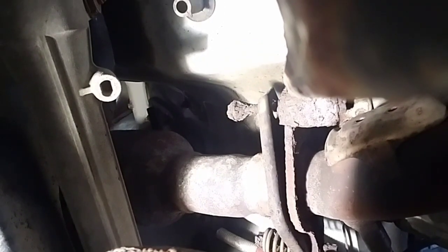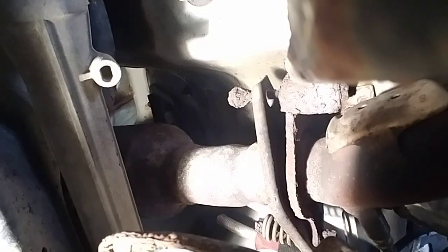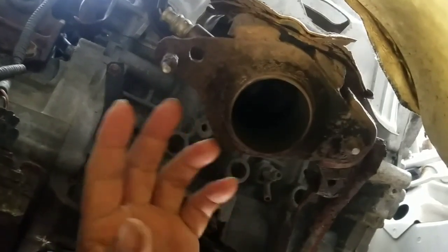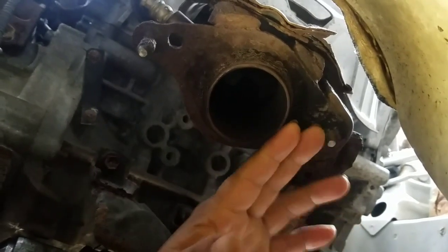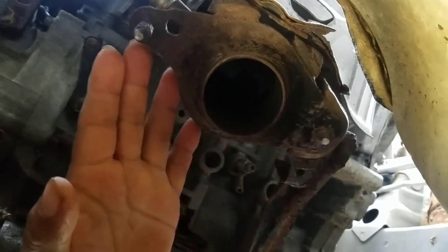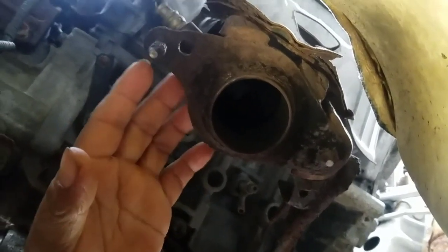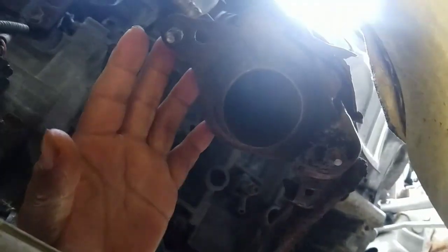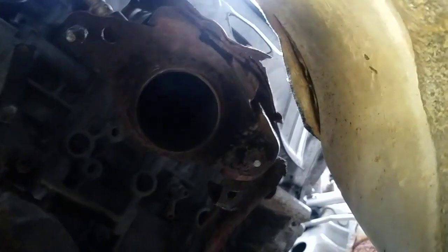It's all worn out — very skinny — I cannot take it out. This bolt over here and this one right here didn't come out. If I try to take it out like this it's going to take me forever, so I'm going to take the whole exhaust manifold out, take it outside, and put a new gasket. I'll have to chew it out or something — there's a lot of work here.